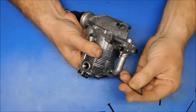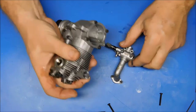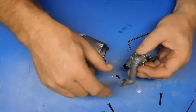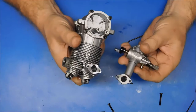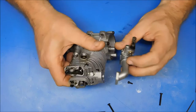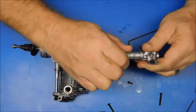It'll be interesting to see if there's a gasket on this intake manifold, and if there is, if it survives. I had a person comment on one of my videos about gaskets — I was doing a semi-rant about how people put silicone around these things. OS has a real tendency of not doing that because they have nicely precision-ground surfaces, and apparently this is another case in point. There's no o-ring or gasket on this thing and yet it probably seals perfectly. If you design an engine properly, you don't need to do that.